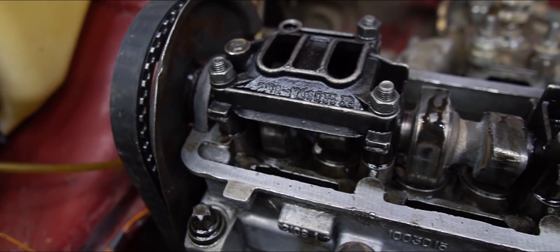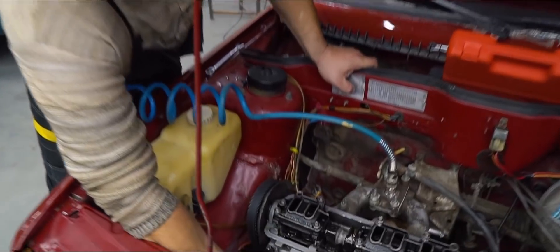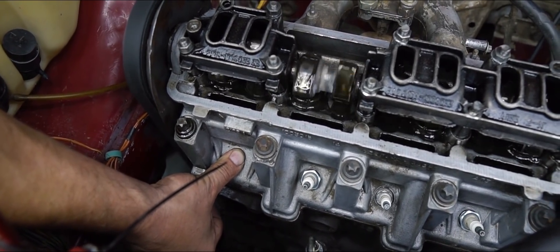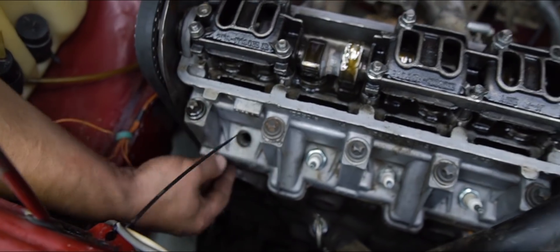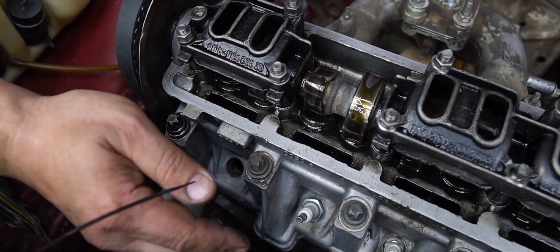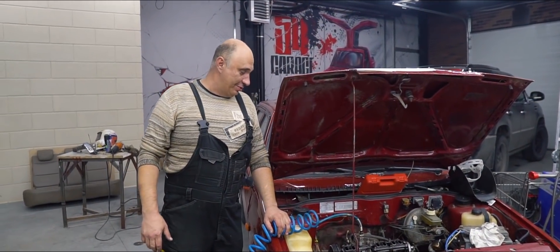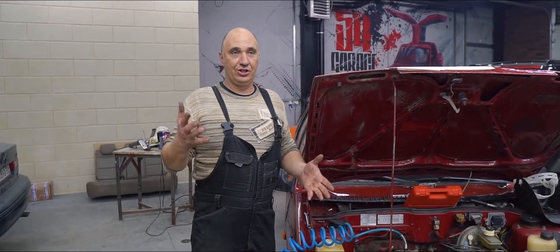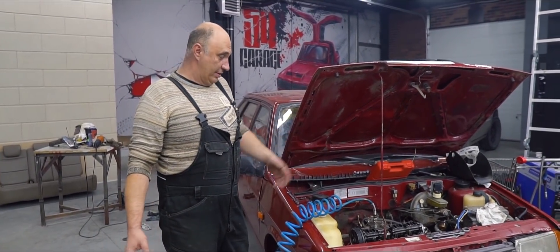Here's where we're at — we're hooking it all up. So far so good. Let it rip. We've removed one of the spark plugs, let's make it spin. It's trying hard to push through. Now we've got plenty of air blowing out. It almost fired up — but there's a ton of pressure. Apparently there's not enough air going in. Curious to find out how much we're lacking. The compressor switches on at about 6 bar and shuts off at 9.5 bar. I'd say we've got plenty of pressure to play with — it should be enough to rotate the crankshaft.